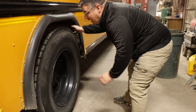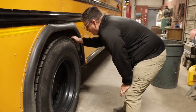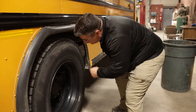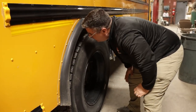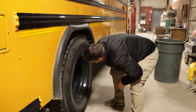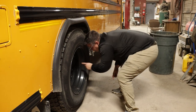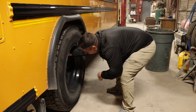I'm going to check my front and rear leaf spring mounts, making sure they're secure, they're not cracked or broken. I'm going to check my flat leaf springs, making sure they're not bent or broken, there's no scissoring. I'm going to check my two U-bolts, making sure they're secured and in place, they're not cracked or bent. I'm going to check my shock absorber, making sure it's securely mounted, it's not cracked or leaking. I'll check the brake line and caliper, making sure they're secured, they're not ripped or leaking. I'll check the brake rotor to make sure it's not cracked, there's no bluing that would indicate excessive wear. I'll check the brake pads to make sure there's at least a quarter inch of pad remaining.